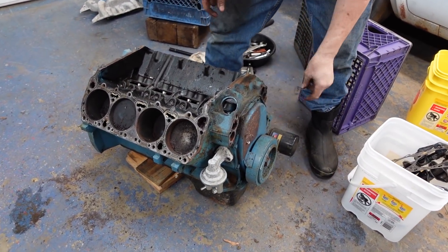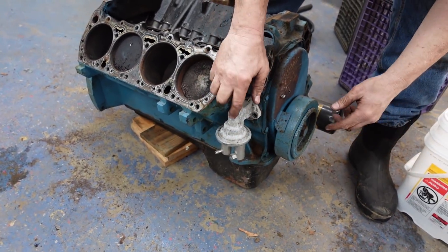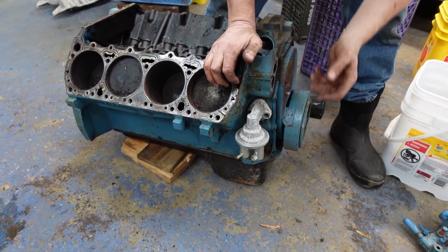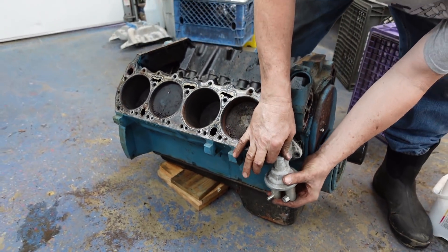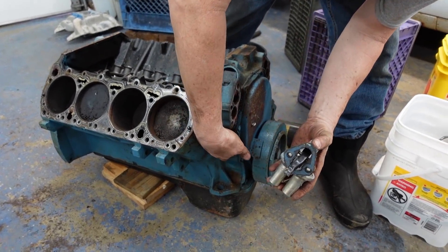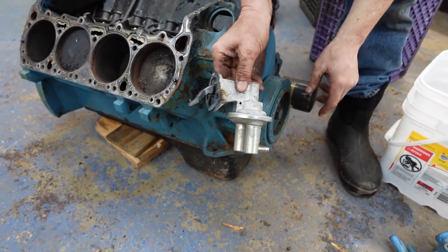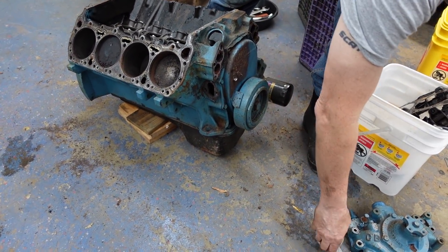Here's the front cover off. The fuel pump on this one is the two-outlet type. There's also a thing called a Hemi pump, which is a much larger structure that moves more fuel. But for this motorhome single four-barrel application, here's the fuel pump. There's a push rod inside that actuates it off the camshaft — just a basic mechanical Airtex device.